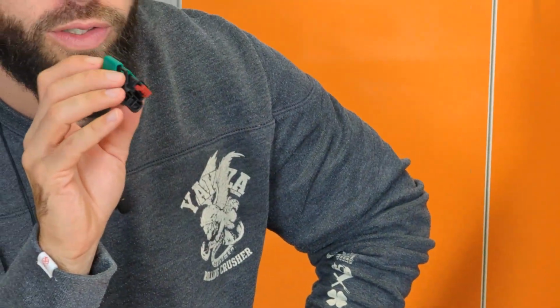So this guy here was at the BMW i3, when you go back in time, the very first versions. I'm pretty sure BMW used the orange one here as well. And so that led to high confusion, as people thought, oh, when it's orange, it is high voltage, but it is not. So this guy doesn't have to do anything with high voltage. It just is bearing the interlock, and that leads to shutting down the high voltage system. Exactly. And just at this point, shutting down the high voltage system doesn't mean to discharge the high voltage battery, all right? It just means that we disconnect the high voltage battery from the rest of the high voltage system.